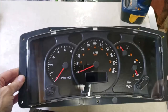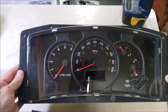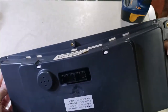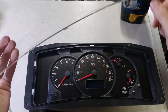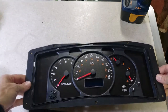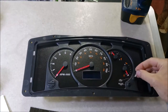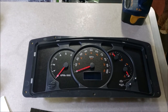I'm assuming if you've already taken your cluster out, the lens is already in - I'll just show you how easy it is to pop it out. There are little clips here - push that in, push that in, go all the way around and it pops right out. One tip: watch these little white pieces of plastic because they fall right out and roll off into the floor just like that. Don't lose those little pieces - you'll need them for sure.